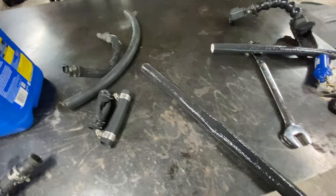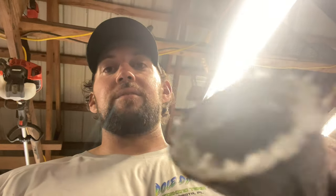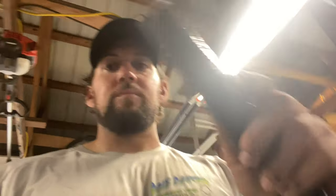Then I actually called up the mad scientist. He recommended that I cover it with some of this heat insulation material that he had given me before for the hydraulic lines that I use for my steering. So I think I'm gonna sleeve both of these lines with this stuff. It's pretty sweet. It keeps your lines from getting hot, melting and getting holes in them, because then your coolant goes all over the tug pad. It's a real inconvenience. You can't even do any tugs, and you make it all slippery for everybody else.